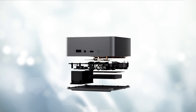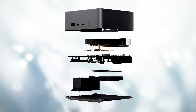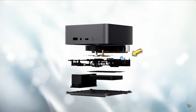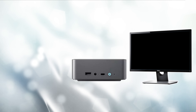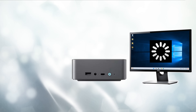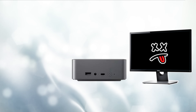This is a tiny PC, and inside this PC, just like any other computer, is a hard drive with Windows on it. All we want to do is overwrite the Windows operating system with Home Assistant instead. You're probably thinking we could just connect a monitor, boot into Windows, download Home Assistant, and tell Windows to overwrite itself. The problem is, Windows would get halfway through overwriting itself and no longer exist to finish the job.